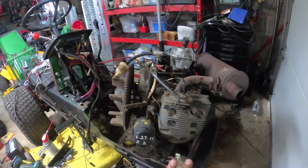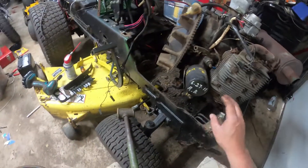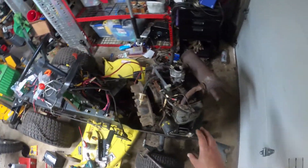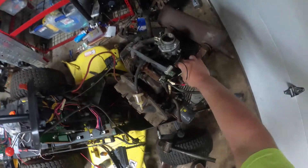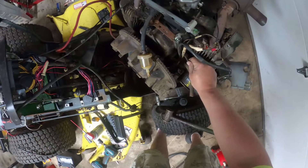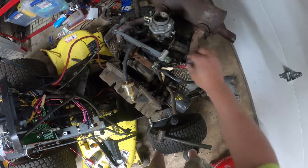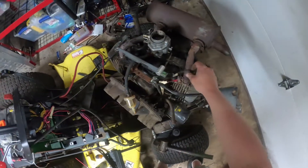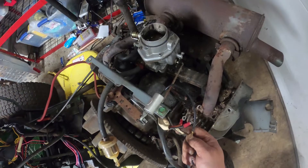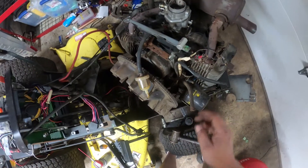Removing the skins - or the heat shields - just helped me see what was going on underneath this mess. What I was really concerned about was the rodent damage. There's some wiring damage here that runs down into your oil pressure sensor, so this could be part of the problem too. We're gonna rewire that and reroute it differently - you can see it's rubbed all the way through.